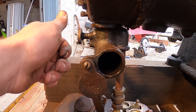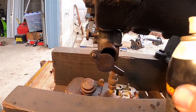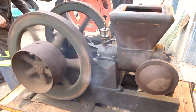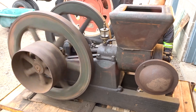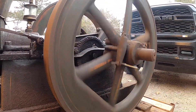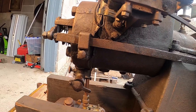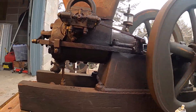Let's give her three flicks — one, two, three. Every one of my Nelson Brothers is that way. Give her a little snort and see what she does. Oh, she's happy! Look at that — that's a happy little engine. When they're running this slow they like to be choked.